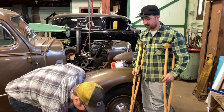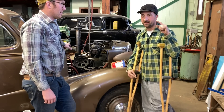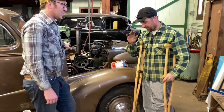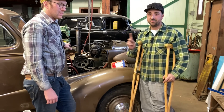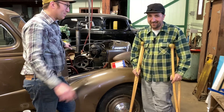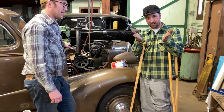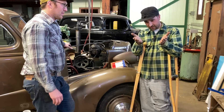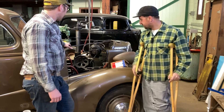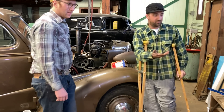If your deck's out of whack, your pistons will be out of whack. This thing will do from a two and a half to four and a half inch bore, 14 inches deep. We were only going seven and an eighth inches. By the run out at the end, we took forty thousandths of an inch at a time till the end, did a cleanup cut, and just kind of snuck up on it — since it's a lot easier to take a little more out than it is to add a little more back. But you still have to have enough to center it on, because of the way the cutters are angled — they sit in the bore, you lift the machine up, clamp it, bring the cutter back, and fire it in. Anyway, that's the Storm boring bar — really interesting.